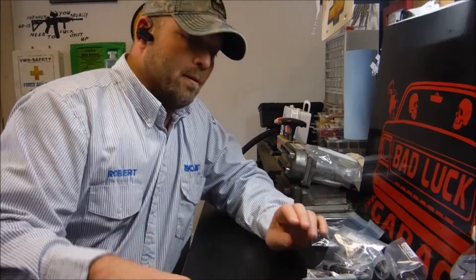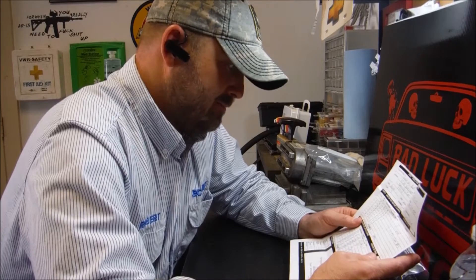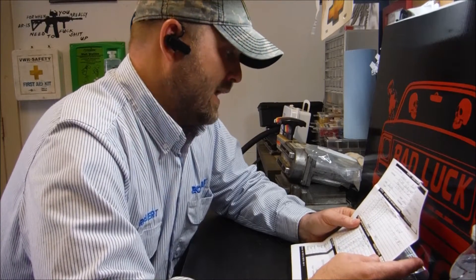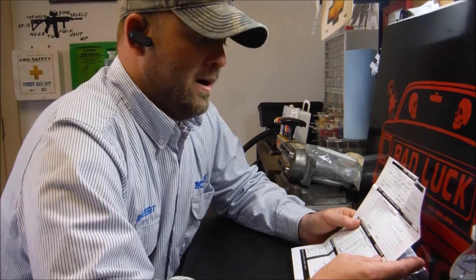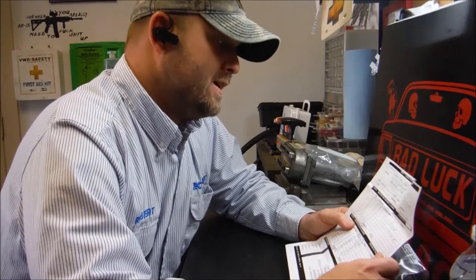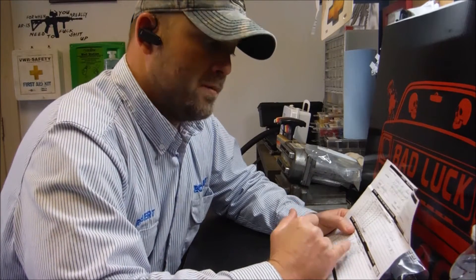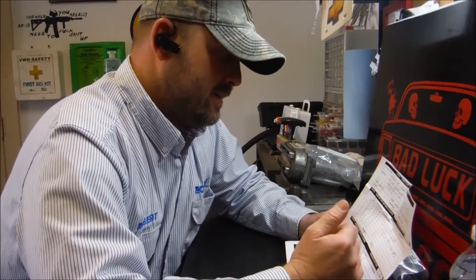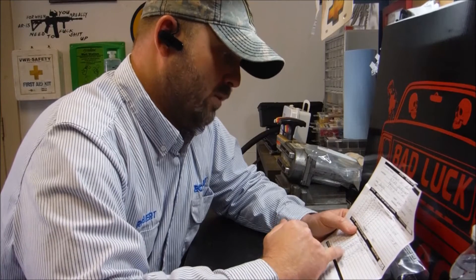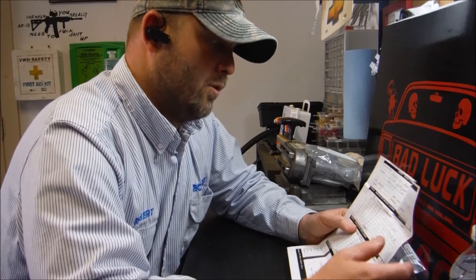I'm looking at these flow numbers and on the dynamic flow rate we've got 63, 65, 62, 65 — that's great, you can deal with that. I could even deal with the 60. There are two of them here that are 60 — that's pushing it from the median. But when you get down here, we got a problem. We got one that's 59 and then we got one that goes all the way up to 67.